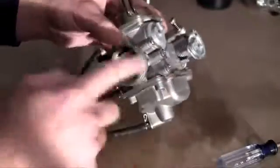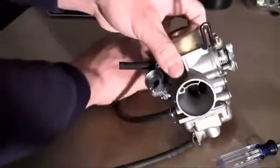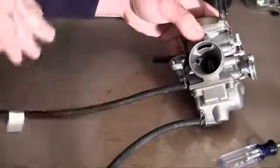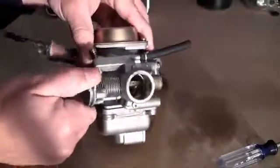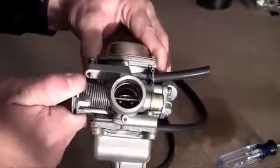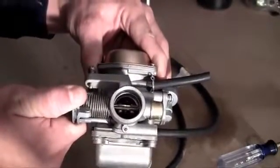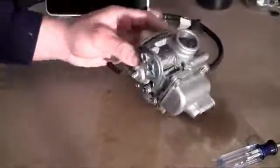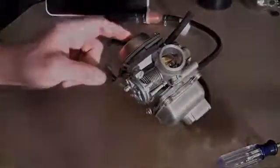So just remember, real quick overview: the air comes in through here on the air intake. The fuel, or gas, from the gas tank comes in through here. Inside, it controls it and makes the perfect ratio. Depending on how hard you're pressing down on the gas pedal, the wider this door is going to open and the more gasoline is going to get into your engine. Now that we understand what the carburetor is and a basic overview of how it works, in the next video I'm going to show you guys how to install this on your go-kart.